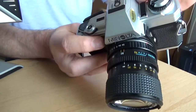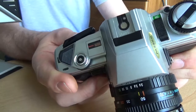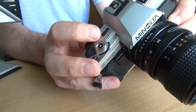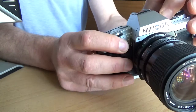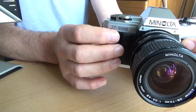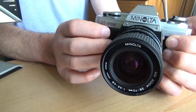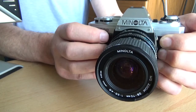On the top lever there's a switch — to operate the camera you need to slide it forward to the ON position. Just a note: this camera is entirely electronic and uses two silver oxide batteries. Without batteries it simply will not operate — there is no mechanical capability. So if you pick one up and it seems dead, it's worth checking that it has fresh batteries in it.